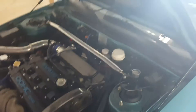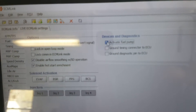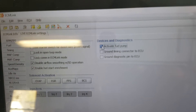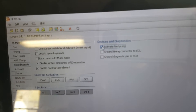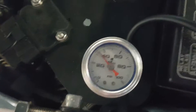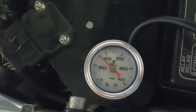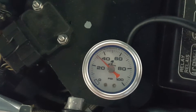So what we're going to do right now is activate the fuel pump without the check valve fitting and see what happens. I already got Link set up on that, so we'll activate the fuel pump. You can hear it running — I just heard it override the fuel pressure regulator. 37, no that would be 30, and you can see it's already dropping. So therein lies our problem.